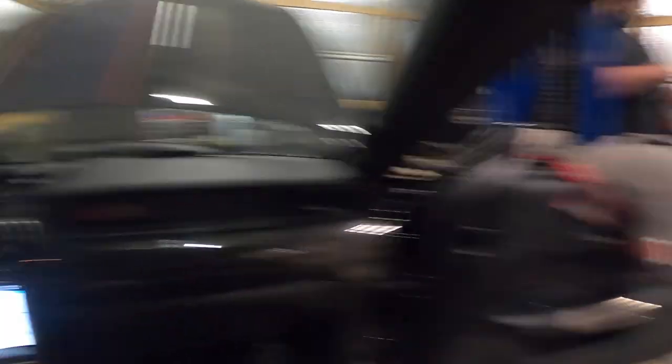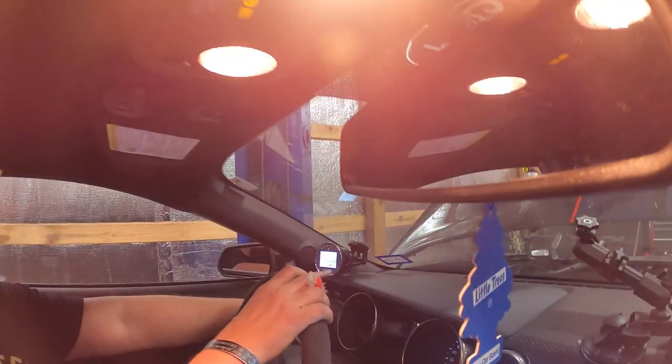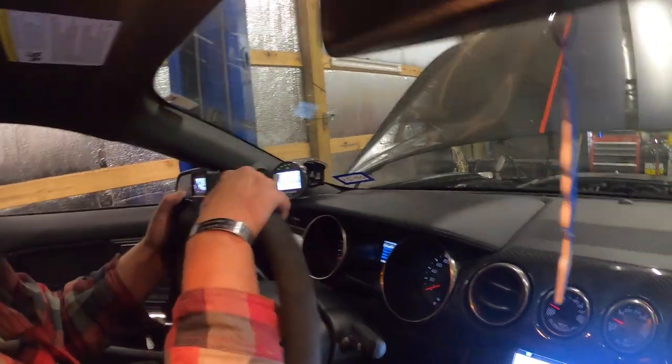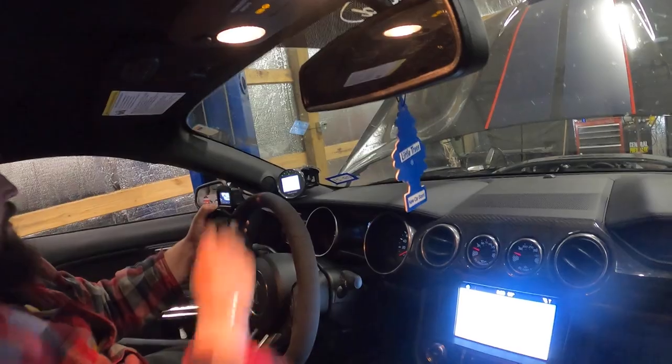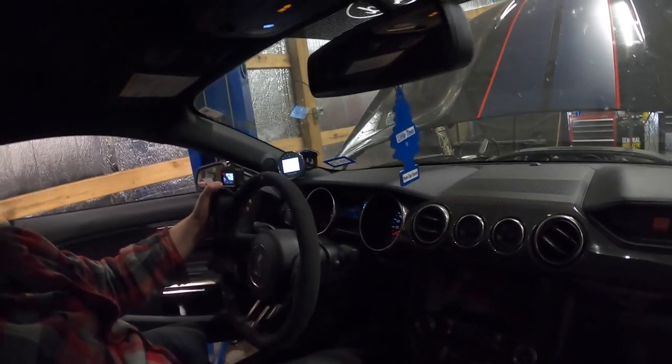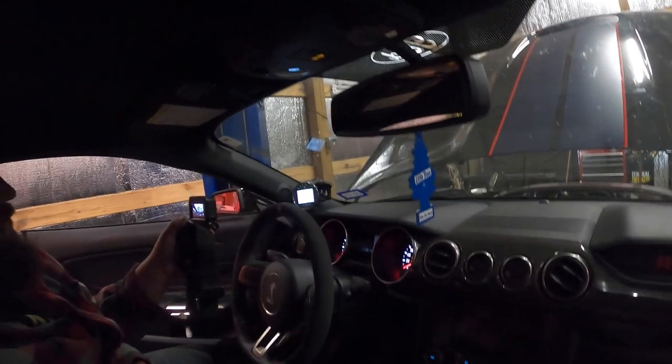We're not going to touch brake tap tuning — load tune. It's a 93 tune, hit the check mark, flash tune — about eight minutes. Don't touch anything. Every time you flash back and forth with other tunes after this it'll be about six minutes.